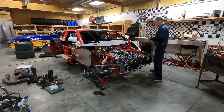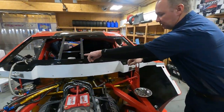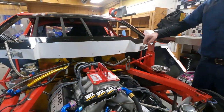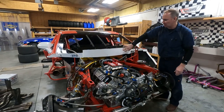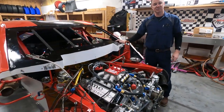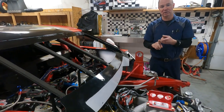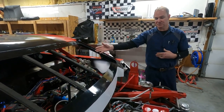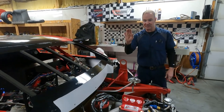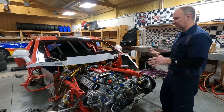The main issue I found with why the dash wasn't working: there's a sensor on the back of the transmission with a barrel valve — because it's a sequential — that comes up and around and plugs in here under the engine compartment. The guys that rebodied the car didn't realize this when they had the firewall off, so that plug was actually inside the car laying under the MSD boxes, not plugged in. When that is not plugged in, the Motec does not know what gear the car is in, it will not auto-blip, and it was actually stuck in what they thought was reverse, which screws the Motec up. You can still drive it that way, but then you have to self-blip and know what gear you're in like most race cars.